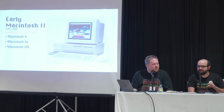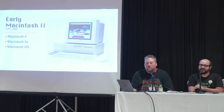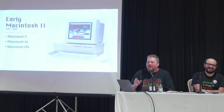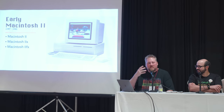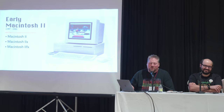Some revisions of these Mac 2 machines have batteries soldered onto the logic board, and in most cases those batteries are required to jumpstart the circuitry to make the machine boot. There are workarounds — you can hotwire it with D-cell batteries. But these are rare exceptions where you do need some battery power. If you're going to store that machine, even if it's a new battery, take it out. Severe battery damage claims the life of many of these systems.